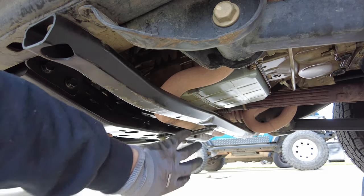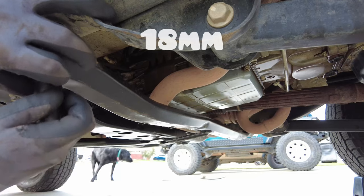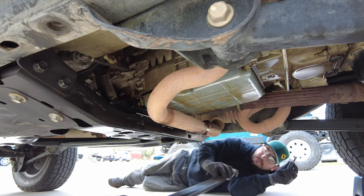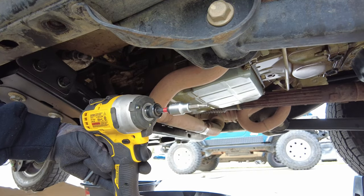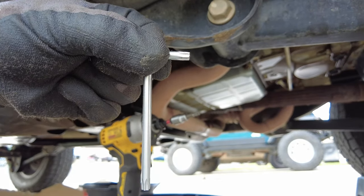The next thing I'm going to do is remove this cross member that ties into the frame. We're going to go ahead and remove all three of the 18 millimeter bolts. I've also got a T27 Torx bit and a small angled one as well. This angled one is going to be the main one we'll actually be using because some of these are really tough to get to.